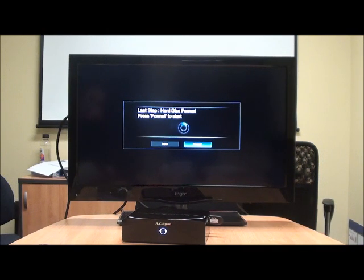So while the actual drive is formatting, we'll just click off a minute and let the format complete. Once it's finished, we'll come back and we'll start running through just how to get to the format option if you want to format a drive that's already in there. We'll also step you through the wireless setup and the network setup for an Ethernet cable — because you can have it on DHCP, which is where your modem hands it its settings, or you can have it on manual settings where you can key in your IP address, your gateway and your DNS servers.